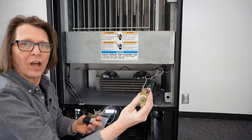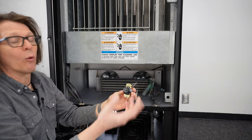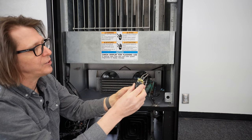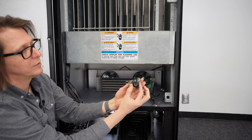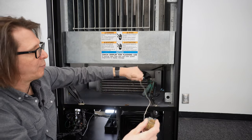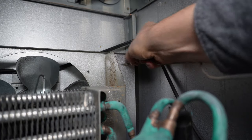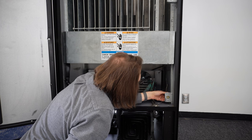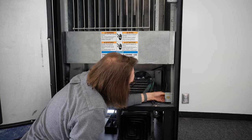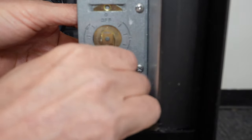The old one didn't have a dial — it used the reference marker on the mounting plate. This new one actually has a dial. I'm going to find the off position by turning it until I hear a clicking sound. So this point right here is the off position. I'll very gently unravel the capillary tube, then stick it into the back of the cold box. I'll mount this up — it's a little tricky because of this notch right here, but there we are. I'll take the screw and tighten it back in.